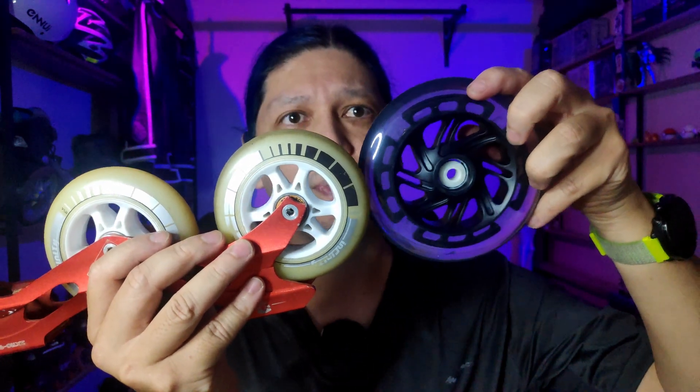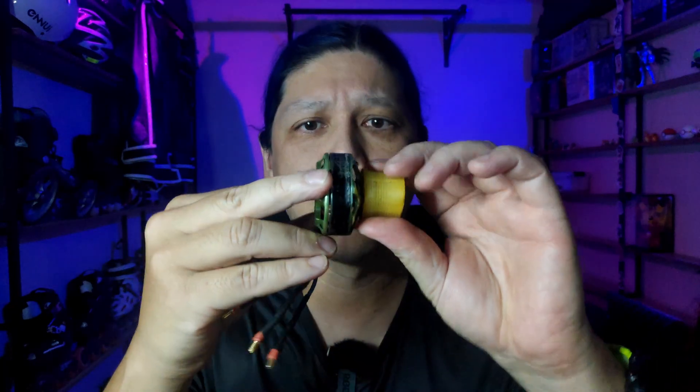If it was the opposite — if you had a really huge driving wheel, let's say 200 millimeters — this wheel would turn once and the skate wheel would turn twice, which means you get more speed. So gears are about torque versus speed. These motors have a high RPM and their maximum power is high at those RPMs. Electric motors have a hard time starting, so it's better to have a big gear ratio. With this friction drive setup, I have a one-to-five ratio, which is massive compared to belt drive which is at most one-to-two. That's why I chose friction drive.